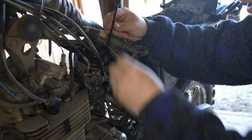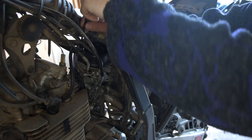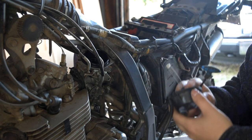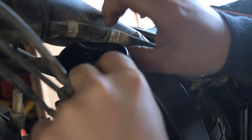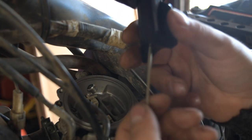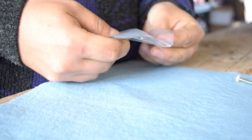Remove the two screws - see how nice and simple that was. Now you can see that the carb easily rotates. There's a little small O-ring inside of here that we don't want to lose, and you can see it's just sitting right there. Now you can pull that slide right out of there. Be careful you don't tear the diaphragm here, and then here is our factory needle.